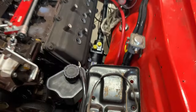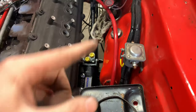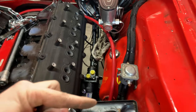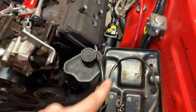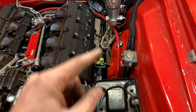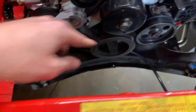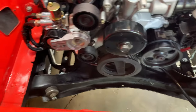And down here, it looks like there's plenty of room, but in reality, once I have my power steering lines coming down here, this guy is either going to be way up over the fender well here, which, I guess I can always get longer cables, but I'm kind of running out of room here, and I don't want this cable to be too long either. The shorter the cable, the better in this case. So I think I'm probably going to go with the front route. And once they're mounted in there, you really don't see the wires, so it's not going to look too obnoxious, hopefully.